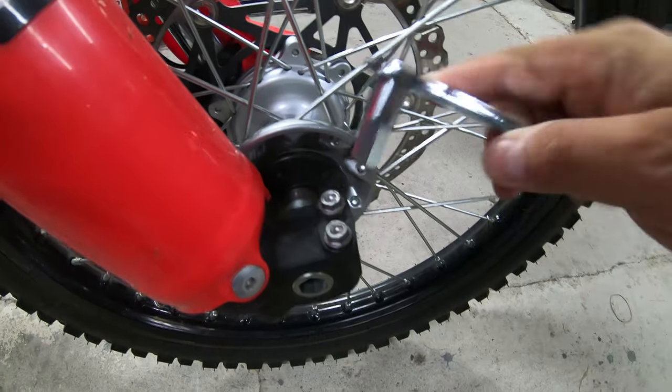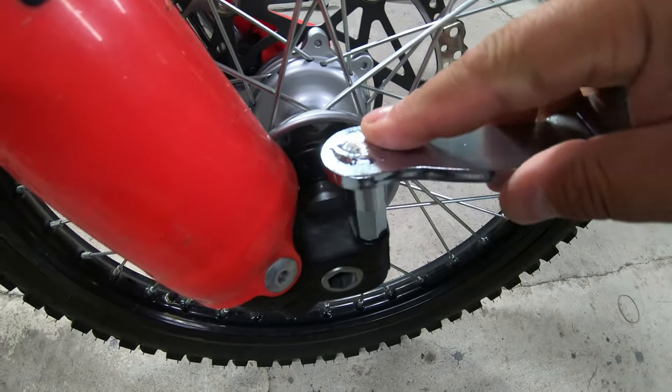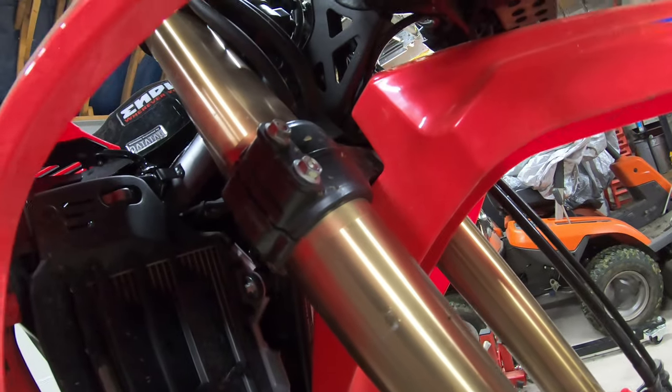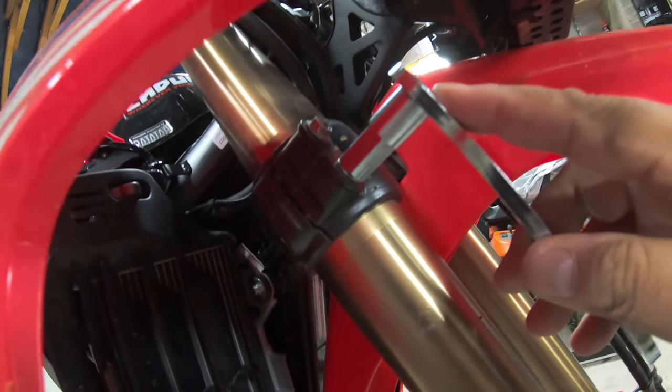At the front of the bike we have the 10mm socket in the middle which will fit the pinch bolt. It also has a 14mm hex on the end which is the exact size to go into the end there for removing the front axle. Moving up to the front for the pinch bolts on the forks — for anyone that's ever had their front end twisted — it's that same 10mm which will fit the bolts for removing the pinch bolts on the front fork.